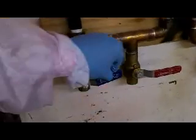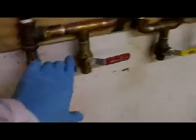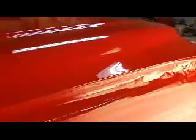We got more water issues, and my pipes aren't trapping it. So I'm gonna have to add my drip legs to here like was suggested to me. Past couple times I painted was fine, but humidity's up today, so bam, here we go. So I put that third coat on. You see that in the light? That's water, dripped out of the hose.